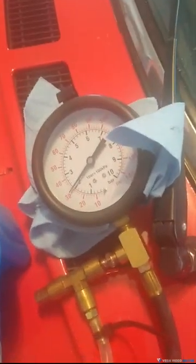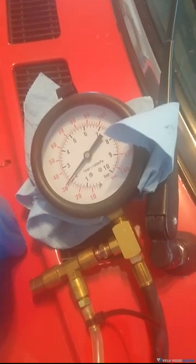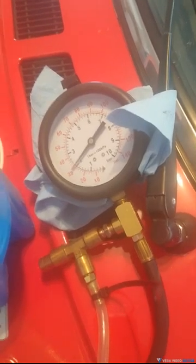The reason I had to do this is because I suspected I wasn't getting any fuel to the fuel rail. When I checked it, it was at zero, and that's how I was able to determine that my fuel pump was bad — with doing a few more tests.